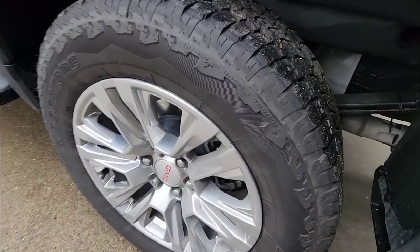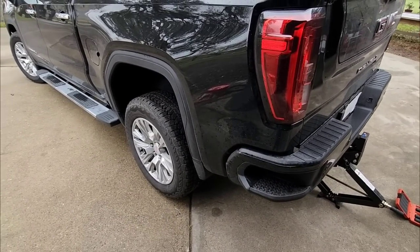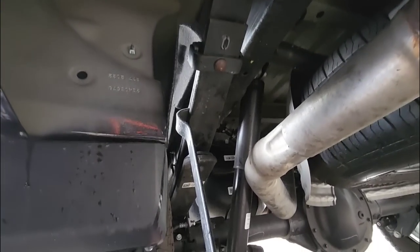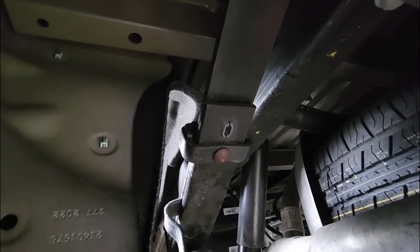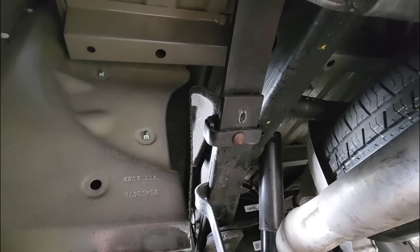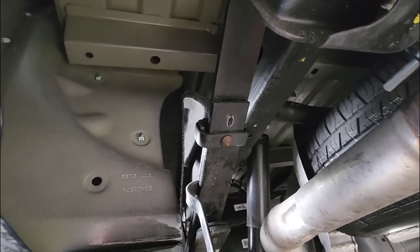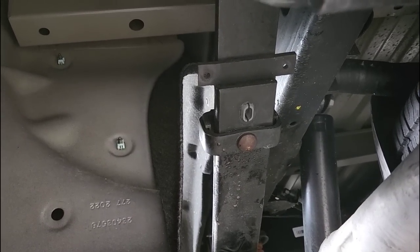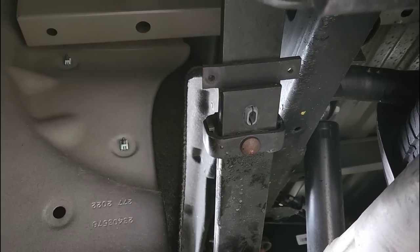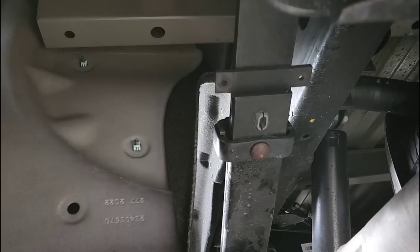The tires aren't quite off the ground, but they're darn close to it. We may have enough pressure off the leaf springs to start separating the leaf pack. We have plenty of tension off them right now. I have a pry bar here, and you can see when I pull on it, it creates some space right there — and that's what I'm going to slide this bushing into. Hopefully that'll fix the problem. We're going to do it on the front and back of all the leaf springs. That was actually really easy to get in there, but you definitely want the tension off the springs and allow them to decompress. We'll run a zip tie through, tighten it up, and knock out the other three corners.